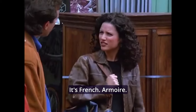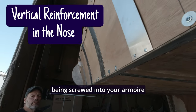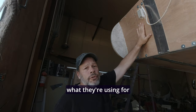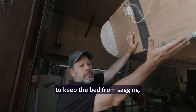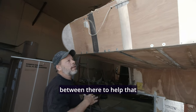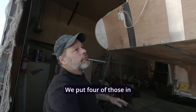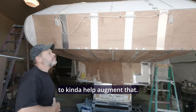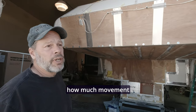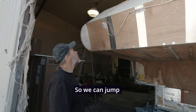So this is what it looks like without the back panel on the bed. This is our closet on the driver's side, and then we have it sealed up — we're going to put another piece on the driver's side, but this would be your armoire. Originally this piece of wood was screwed into your armoire and closets, and that's what they were using for rigidity to keep the bed from sagging. To offset that, we put some strapping between there so it's not putting the strain on the wood but into the structure — we put four of those in. We were getting a lot of movement so we're narrowing that up, and now when we're inside our bed isn't actually squeaking on the floor.